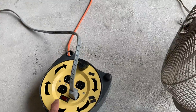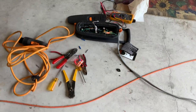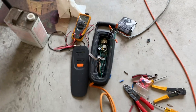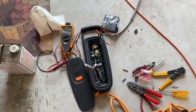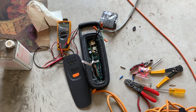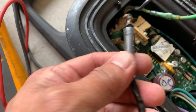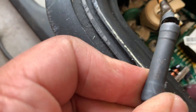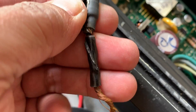I'm far away and I switched on the power — but I don't see any light come on. So my suspicion was right: that black device has something wrong with it. It's probably shorted or open internally. I couldn't find anything about it online under the QS-2 marking, so I decided to just cut it open.